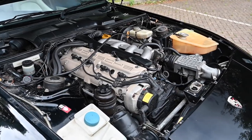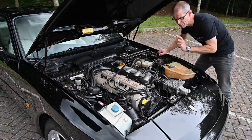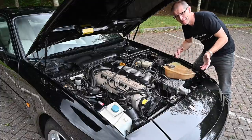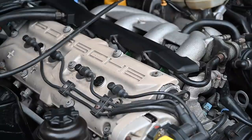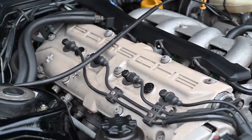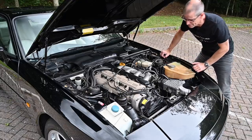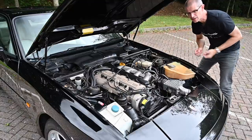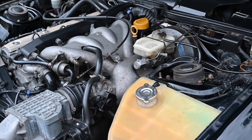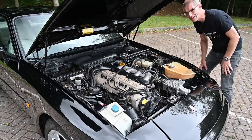In the new S2 version this is the three litre. I did read somewhere — don't hold me to this — that this was the largest production four-cylinder in the world at the time, though there were and may have been bigger four-cylinders in production. If you think back to early cars like the Model T, there were ridiculous numbers of litres for a four-cylinder making about 12 horsepower — this was a different kettle of fish. It's an all-alloy 2,990cc engine, normally aspirated, which makes 211 horsepower and 207 pound-feet of torque — quite a lot on a little car like this.